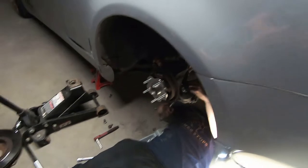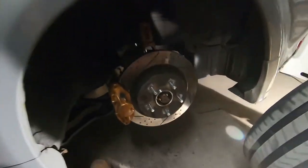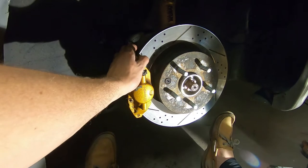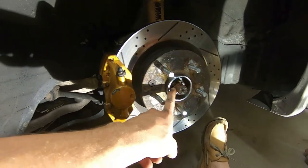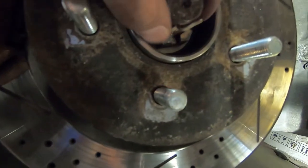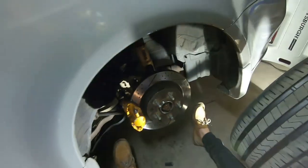Before putting the tire back on, put the axle bolt in the center — that was a 38 millimeter for this car. Quick recap: tighten the four bearing bolts, put your caliper bolts back (normally two, top and bottom on the back side), then put your axle nut back — 38mm on this one, a lot of them are 32mm. Put the cotter pin back through and bend it open with pliers so it can't come out. New bearing is in, rotor wiggles because it's a floating rotor but everything's good. Put the tire on and that's it — catch you guys in the next one!